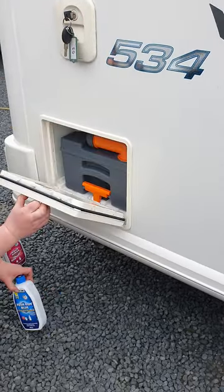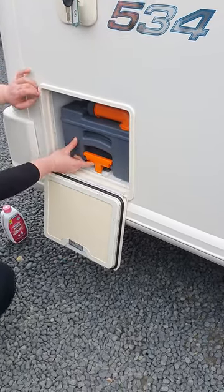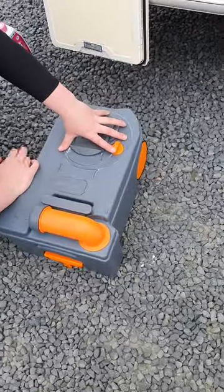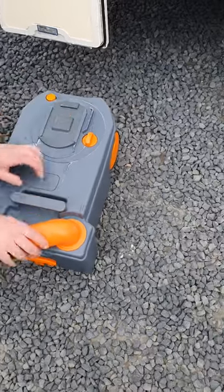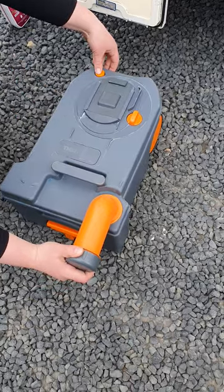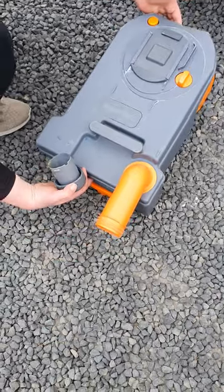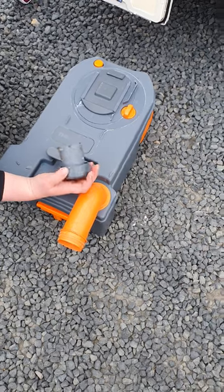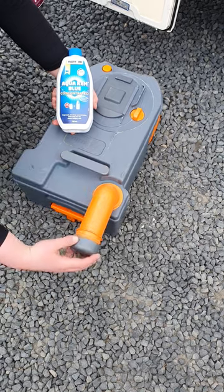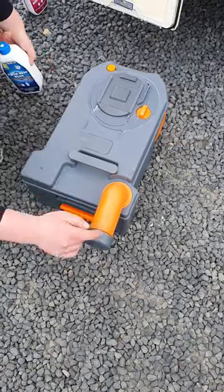Underneath here in this locker is your toilet cassette. When you go to remove this, you'll need to lift it up over this little bridge and slide it out. The items in this circle are operated inside the van so you don't need to worry about that. When you go to empty it, you'll spin your spout out. If you're having a bit of trouble getting this cap off, you do have an air release valve at the bottom here so you can push that a few times and then that cap should come off. There are some measurements on this cap here — this is designed so that you can measure out the blue toilet chemical. It helps with smell but it also helps break everything down so it's nice and easy to empty.